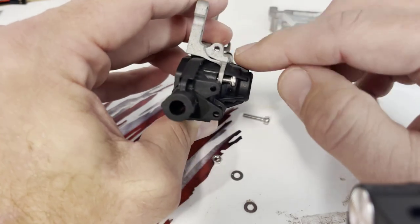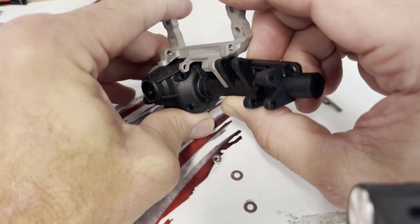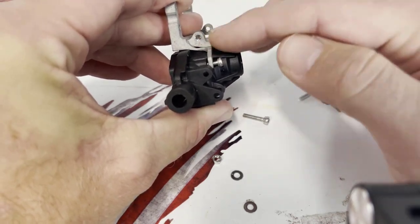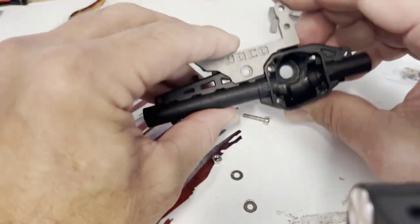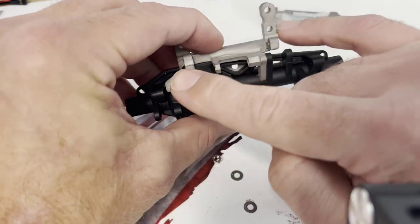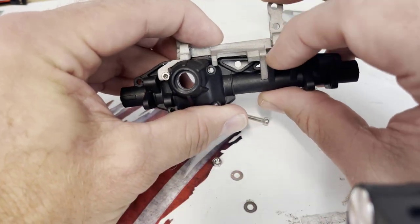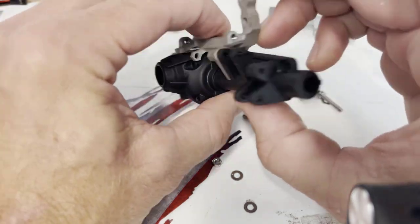The other option for link mounts is the side ones, which are higher. Those are going to be the easiest for packaging because they go straight up over the axle — you don't have to worry about coming up and over the diff housing or the drive shaft; the links will be pretty much straight up. So it's pretty straightforward: just a few options depending on whether you want to use the center triangulated links or the raised upper links. M2.5 by 20, 3 by 30, 3 by 16 depending on what you're doing, and then a 3 by 14 through the truss to secure it.